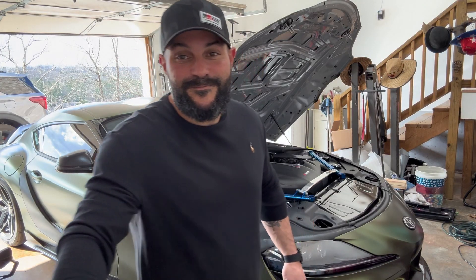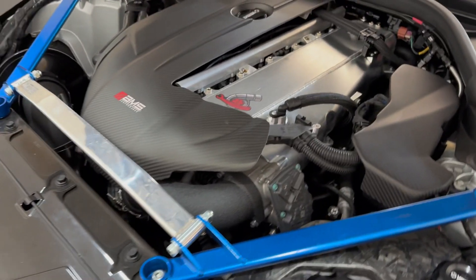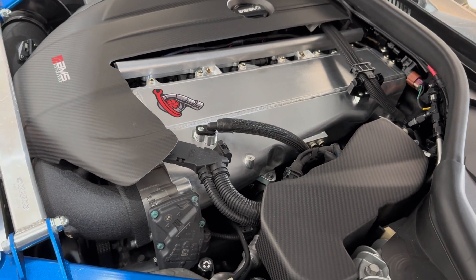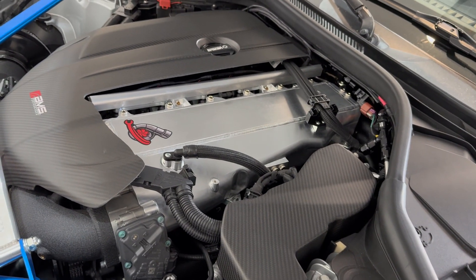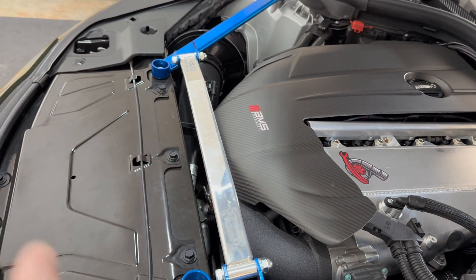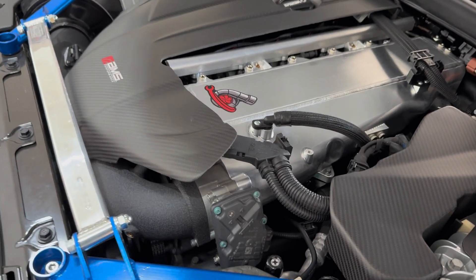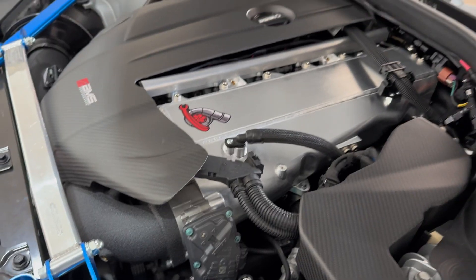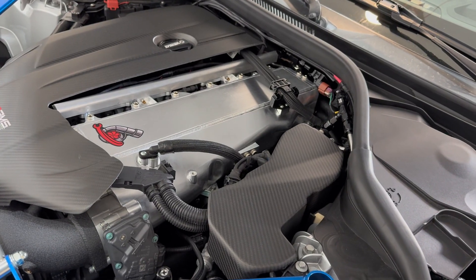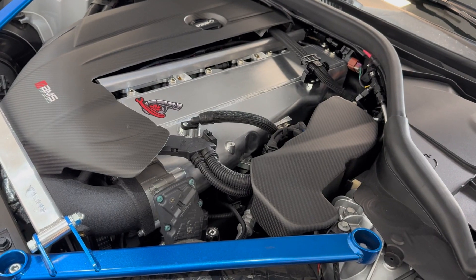Initially what we chose to do with this manifold was keep the top line. I ran the line coming from the tank as well as the actuator under the manifold, and deleted the front portion that feeds back into the turbo. Now I'll be installing a cap here and a small filter check valve on the line coming from the tank, so it'll just be a vent-to-air setup.